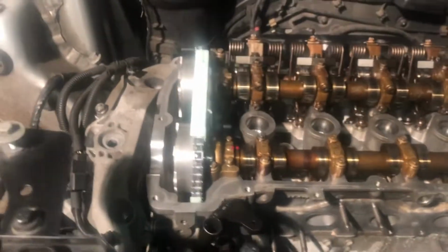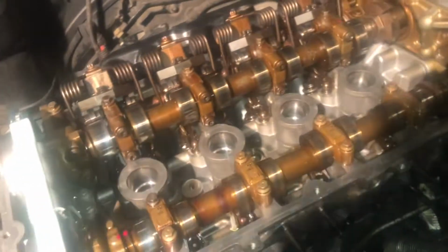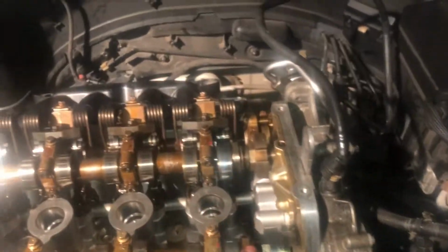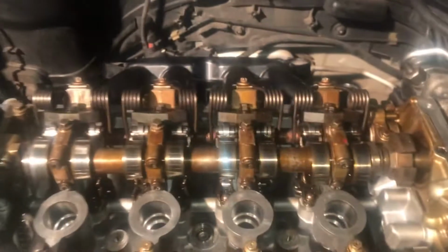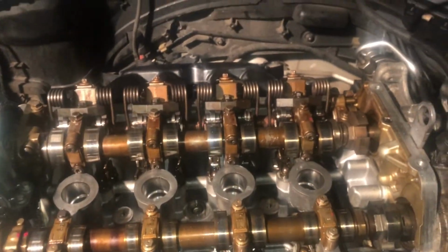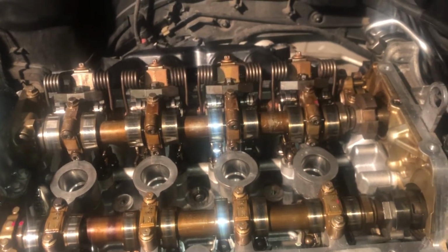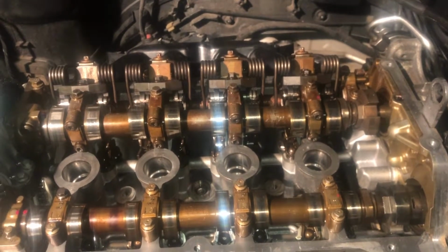Right then, so it's slowly coming together. So we've got the top kind of guider on. We've got the guiders on the inside on, obviously. I've timed it up and things. So in terms of doing the timing, I did have my timing tool on here. And ignore these marks a second. I'm going to redo these, just to keep it old school, because I like to have the marks there. Anyways, so I've used the timing tool to check everything, taken the pin out from underneath.